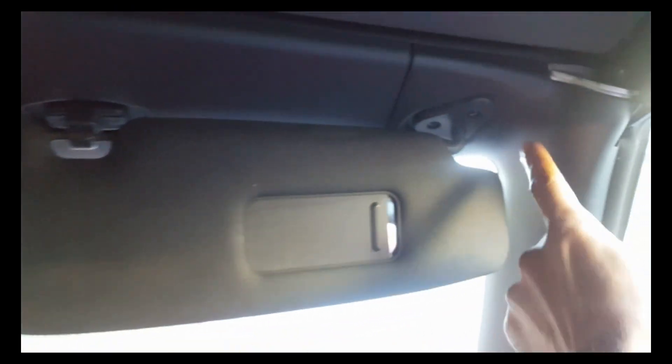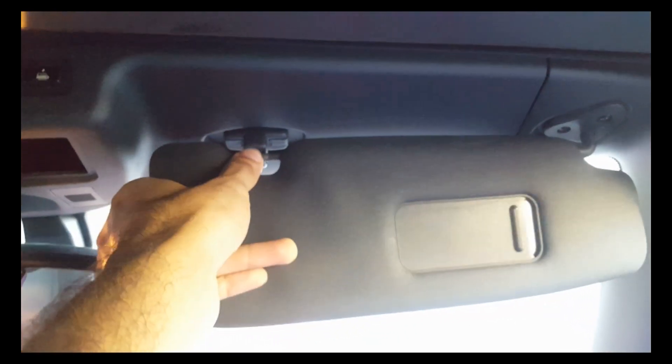In order to pull this panel down, you'd have to remove this here — there are some Torx screws underneath. You don't have to take off the visor; the visor is attached over here and it's not part of this panel. You just have to pop this off — take a screwdriver, pop out those little things on the side, Torx will take this out. Take them both out, pop the whole panel down. You can see there's a gap on either side where you can put something in and pop it down. There's also a crease that goes all along the top.